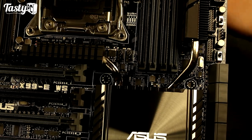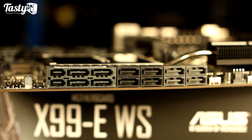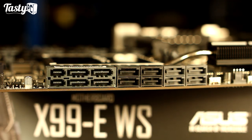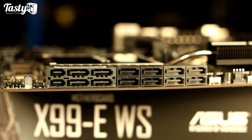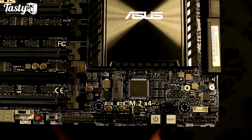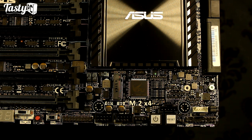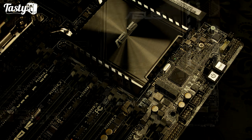Underneath that we've got the SATA connectors — eight SATA 3 6Gb/s connectors and two SATA Express connectors. Although if you want to, you can disregard the SATA Express functionality and use the board as if it's got 12 SATA 3 6Gb/s connectors. The bottom SATA Express connector is powered by the ASMedia 1061SE chip; all the rest are Intel, but the two black ones don't support Intel Rapid Storage Technology or RAID. Under here we've also got an M.2 socket 3 slot which can support either 2260 or 2280 sized SSDs. Below that there's a case fan control setting jumper which you can set to either BIOS or PWM, which by default is set to BIOS, so you can still control everything in BIOS or using the Fan Expert software.